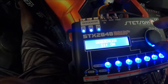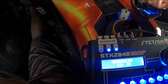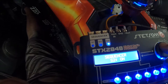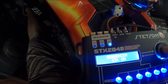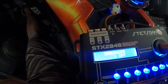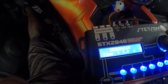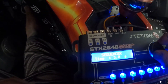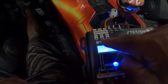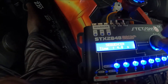So we're going to turn the sequencer off. As you can see the light went off — go to two, turn it off, and you can see the light goes off. Go to three, turn it off. And here's where you set the timing: two seconds, two-and-a-half, three seconds, three-and-a-half, four seconds. So it'll turn your amps on or off four seconds apart and so on.